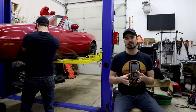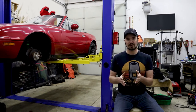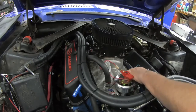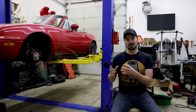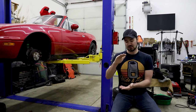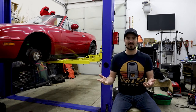When I ordered the kit a few weeks before the trip, figuring I had plenty of time to get it installed and dialed in, the supplier through Amazon had sent me the wrong distributor — two different distributors with almost the same part number for the same engine. One is for high-rise intake manifolds and one is for a standard low manifold. They sent me the high-rise manifold distributor, which is actually much shorter to go underneath the intake manifold. With my cross-plane intake manifold there was no space and I couldn't actually drop it into the engine at all.